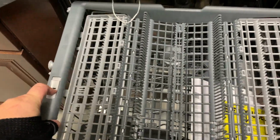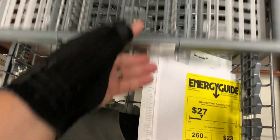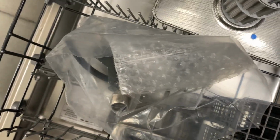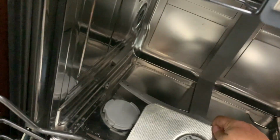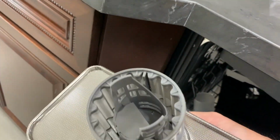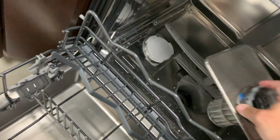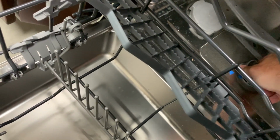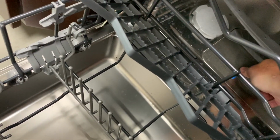What that means to you is that a soft food disposer is going to, instead of trying to shove those chunks down the drain, what's going to happen now is, you see this mesh screen? The water is going to push that food up against the mesh screen, and it's going to turn that food into mush. And it's going to send mush down the drain. Anything that cannot be sent down the drain is caught, and you can dispose of it properly, which means this unit is going to clog up far less often than something with a hard food disposer.